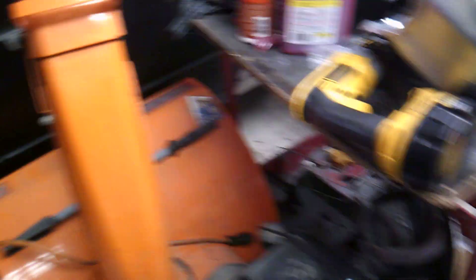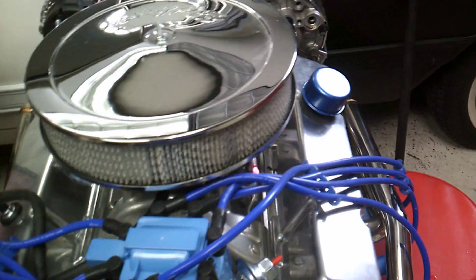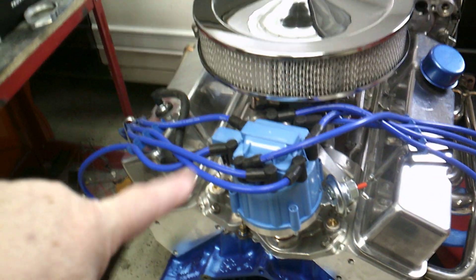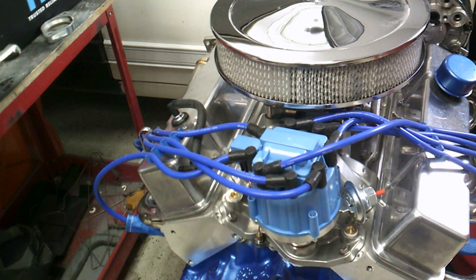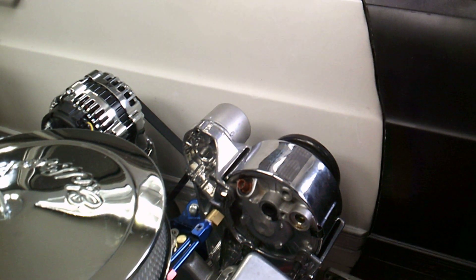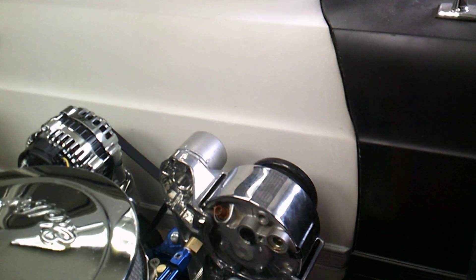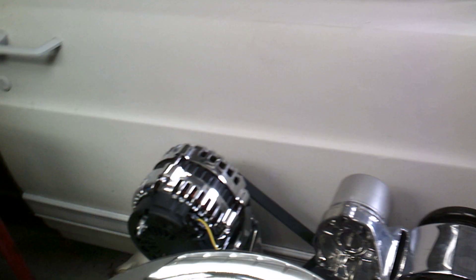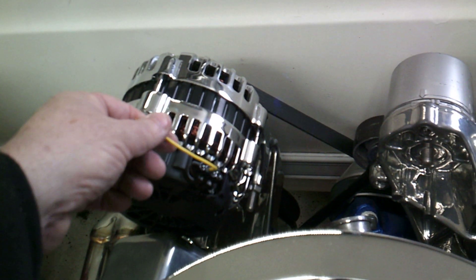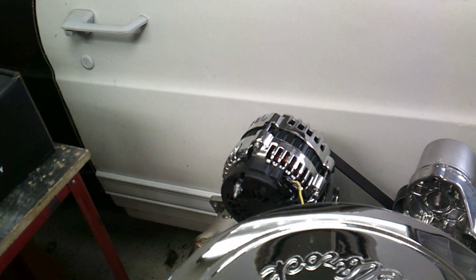That's kind of where I've been and what I've been doing. The snow blower — that's the other project. I'm a little sad because if I go to the electronic ignition system, I'm going to lose my blue distributor cap, which I had to look high and low for. On the air conditioning compressor I found a company that makes a chrome cover — I think that looks pretty cool. I also got the resistor wire because when you run a modern alternator, you have to have this resistor wire, otherwise it basically tells your charging system to charge incorrectly.